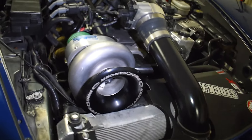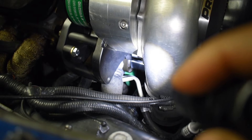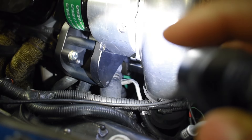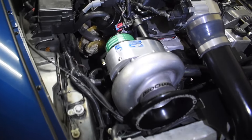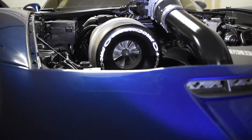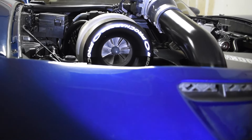I also had to shave a little bit off the water pump housing right here, because this idler on the tensioner was pretty much riding on it. Shaved it down to create a little more clearance and good to go. One thing I noticed with the A&A bracket is that the supercharger does look to sit up a little bit higher than it was before, which is fine because now I have a more streamlined flow for air. Still not running the screen - full send.